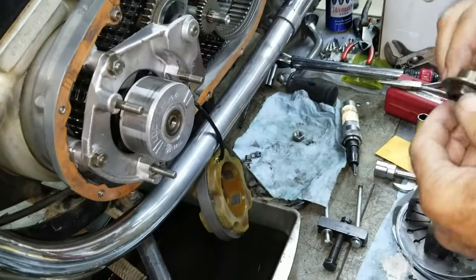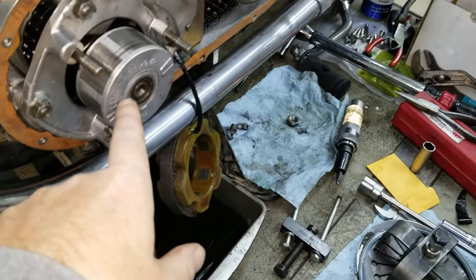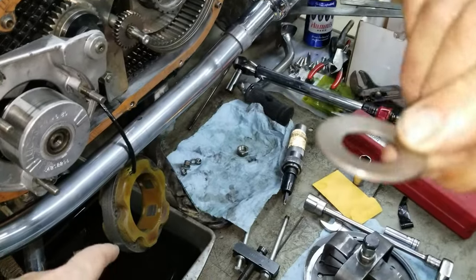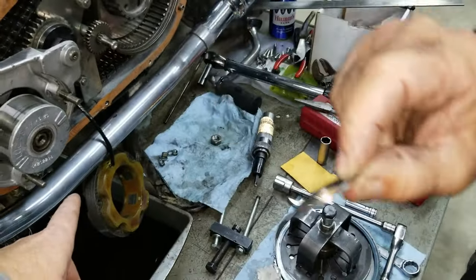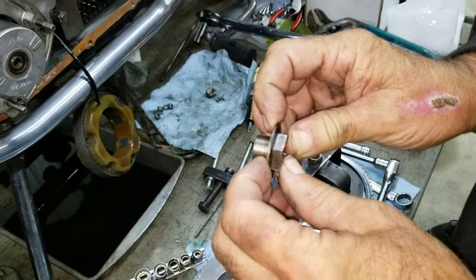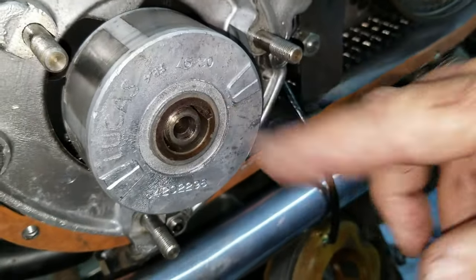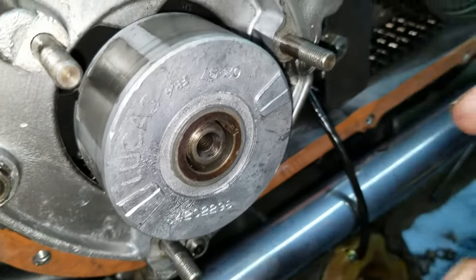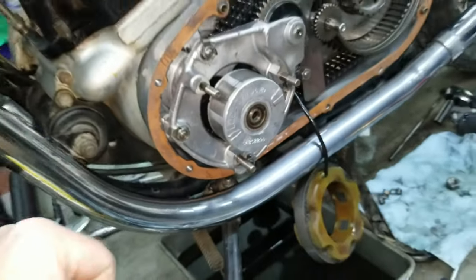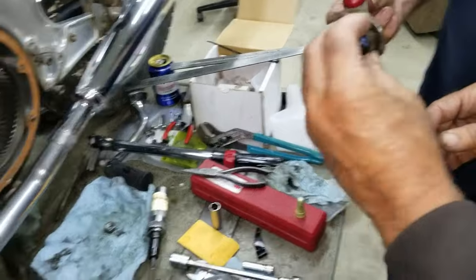Want that? Yeah, Loctite. We got the Belleville washer on there. We talked about this before. It's a Belleville. Belleville is what they call it? Yeah, I call it a Belleville. It's a beveled washer, but it's called the Belleville washer. And what happens is as you tighten this up to full torque, that puts pressure on this outer part and onto this hub, and it keeps spring pressure in it so it won't come loose, so it stays tight. And we always put blue Loctite in them, too. That's good.